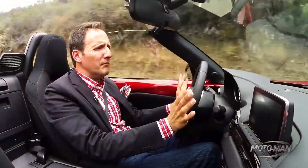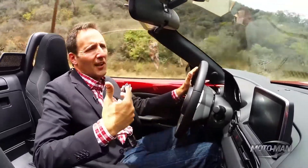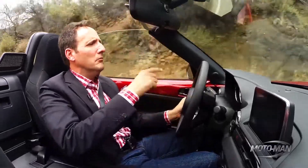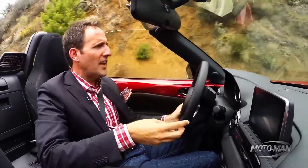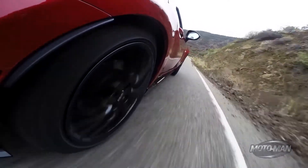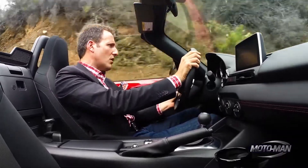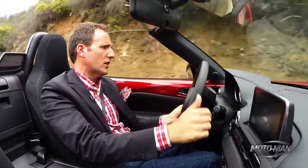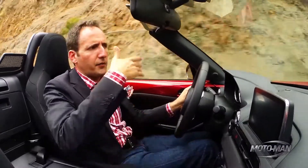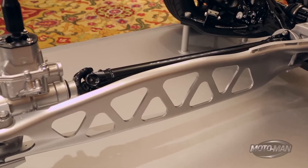So that's a dizzying array of moving parts to keep straight. How does it all translate to the road? Rather than just tell you, let's unpack why this ND is more fun to drive and more balanced — and there are really three reasons. Number one, the construction: the fenders, bumpers, control arms, the bit separating the passenger compartment and trunk, even the leading edge of the roof — that's all more aluminum. And the second piece, if you're familiar with Miatas, they've always had these power plant frames — like Corvettes have a torque tube, kind of a similar concept.